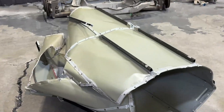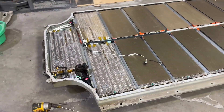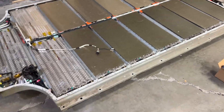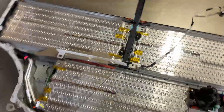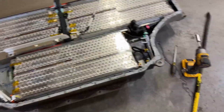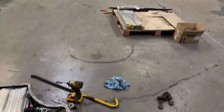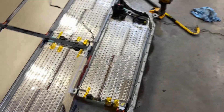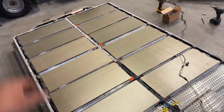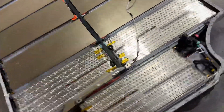The top portion of the battery is cooked, but this thing looks like something out of a spaceship. I'm slowly going through and taking apart all of the connectors and the bus bars — they're all just a 13-millimeter bolt. I've taken one off so far, this one will come next, and I'm just going to slowly work my way down, taking my time and making sure I'm double gloved up.